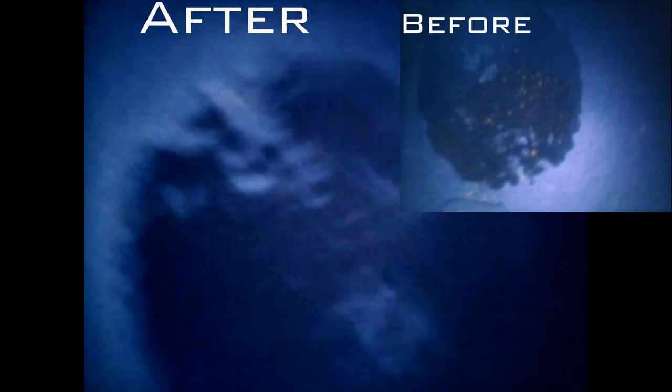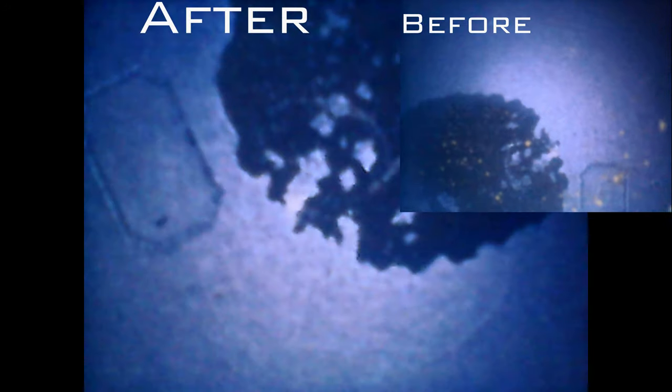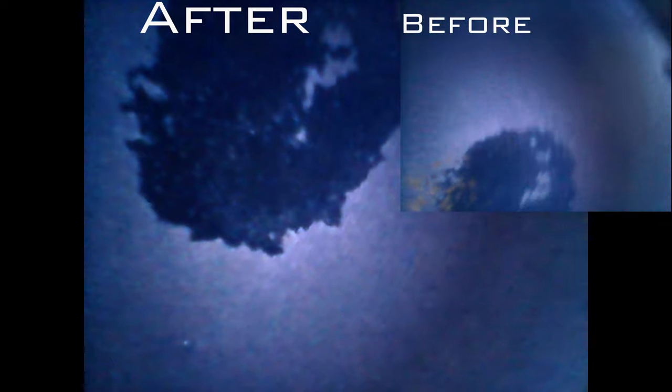Entering cylinder number 1. Looks like it cleaned the rust spots. Cylinder number 2, the carbon is still there, but the rust spots have been removed. Cylinder number 3, just like cylinder number 1, no rust spots. Cylinder number 4, here we can clearly see that the rust spots are gone, but the carbon is still there.